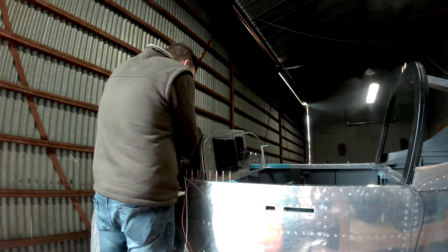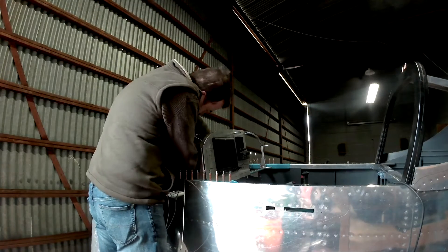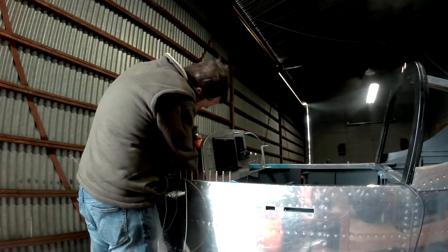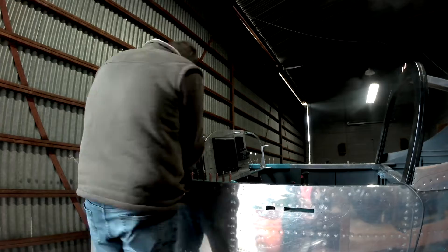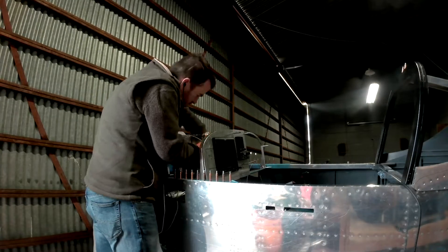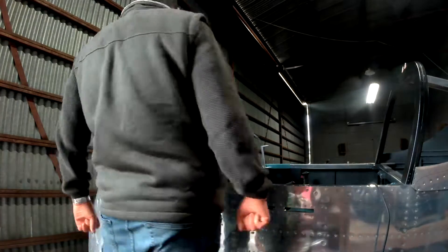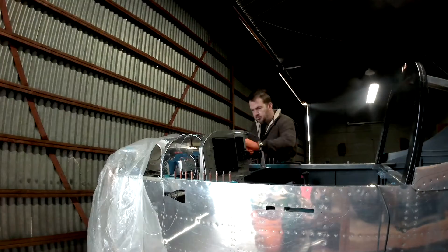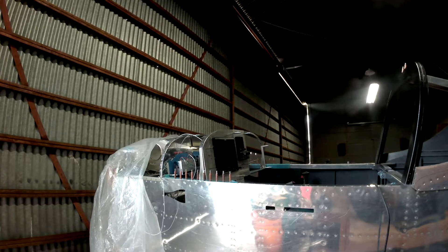The other document is the center of gravity sample CG chart. The CG range on this thing is only about 10 inches front to back — very narrow, as most planes are. There is a known issue in this model where some people have experienced CG problems: single pilot, a lot of baggage in the back, and low fuel. The fuel is on the leading edge of the wing, so as you use fuel it naturally moves the CG backwards — single pilot with baggage in the back can push the center of gravity out of the back of the envelope.